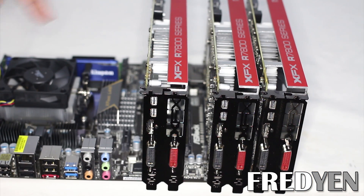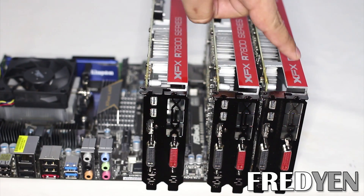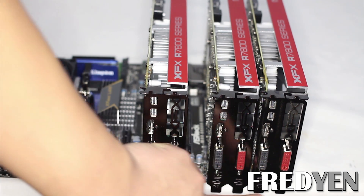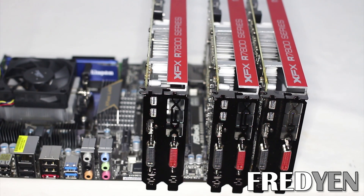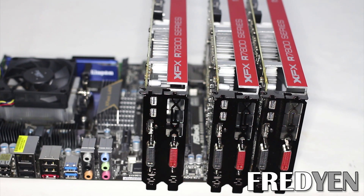Here's something you need to take note of. As you can see, between GPU 1 and 2 there's a good amount of room, however between 2 and 3 the spacing is actually pretty tight. Depending on the hardware you decide to use, this could cause some overheating issues. With my particular setup, I don't think I'll run into problems because I'm going to have a box fan blow across all the cards, which should keep everything pretty cool. Another option — which is very popular — is to put this entire setup in a milk crate. You would need riser cables for each card, which allows you to lift all the cards above the motherboard giving extra airflow. I am going to eventually transition into that milk crate setup, but I'm still waiting on my riser cables. Until then, running it like this with a box fan should be perfectly fine, but it's something you should definitely monitor.